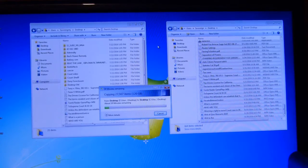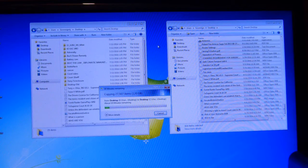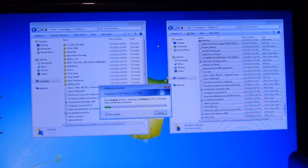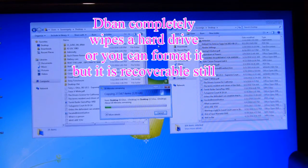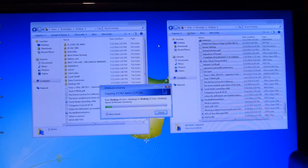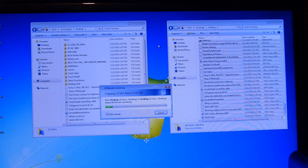Here I've opened up the old hard drive. I plug both drives in at the same time, open them up until you get to the same folders on each, then press Control and drag-and-drop them over to copy everything to the new hard drive. You still have your old stuff, and then you can wipe the old drive if you're giving it to somebody. If you're replacing your hard drive with a bigger one in your own computer, you can do a clone instead — that's a much faster way of transferring everything over without reloading all your programs and Steam games.